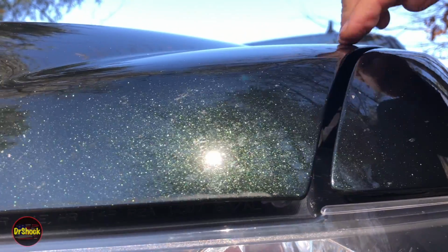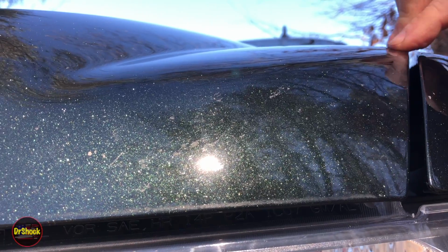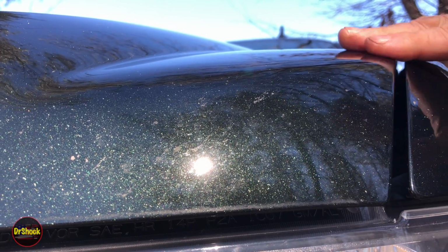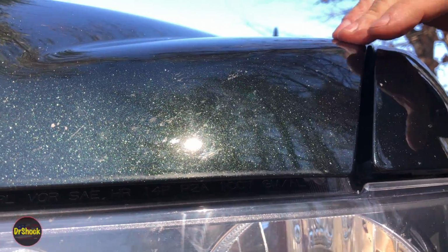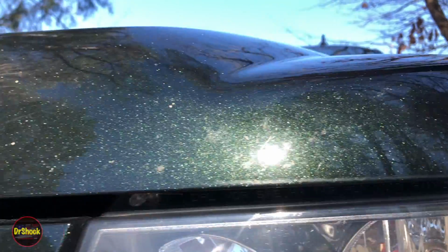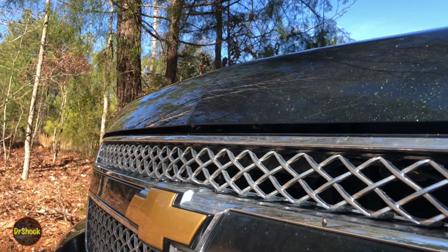Now maybe it's still off a little hair, right? Maybe I'll adjust it 1/4 of a turn more. But that's what you want to do to get rid of hood flutter. And then after you adjust this side, you may find that you have to tweak the opposite side as well, just because now it's out of balance again. But that's what you want to do.